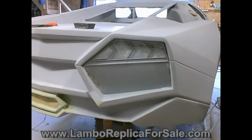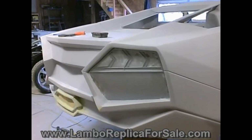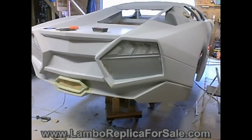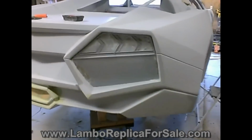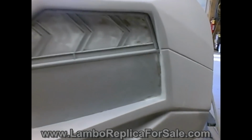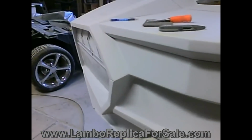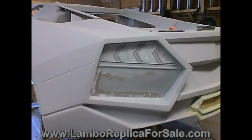And we also put a plate there where the grill mesh will mount. That way you can just cut out the area in the center and you'll have your border around it. It's always a little extra work you have to do when building grill mesh for these things. You have to figure out how to hide the edge where you cut your mesh to fit in. We can just cut out that fiberglass and leave a half inch edge all the way around, and then mount the grill mesh right behind that, and that edge would be your border around the mesh. Paint that flat black with the mesh and it'll look like it's the actual trim made for the grills.